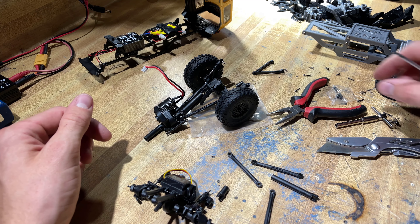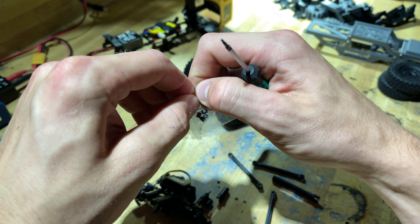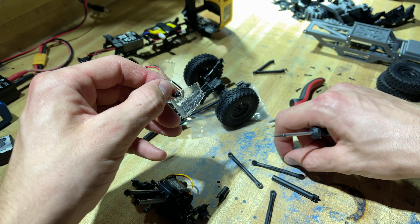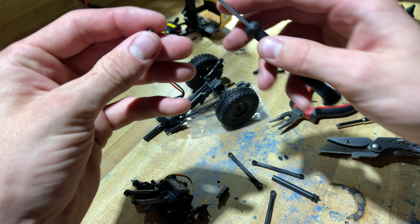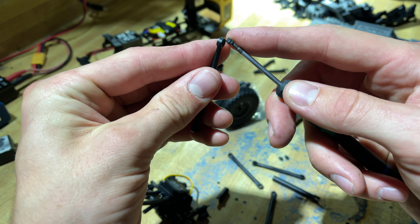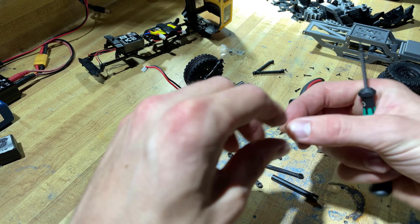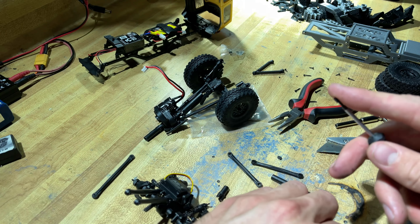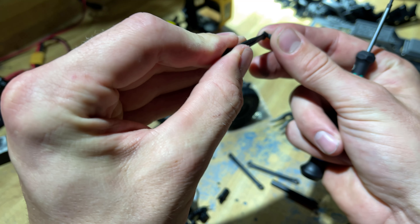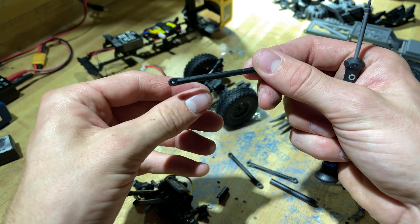Now grab your extra pillow balls — you can get them from the kit linked in the description below. I personally found these on eBay and they seem to work all right, though they take a little more to break in and you've got to trim them a little bit sometimes. Get three of those out — same thing, put it on the end of your Allen driver, grab the new link, push it in and it snaps right in. You don't necessarily need to use the pivot ball links — a lot of people use Teflon tube or whatever you can fit in there to close the gap and still give you the flex you want.